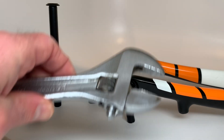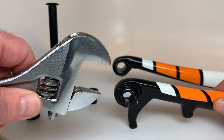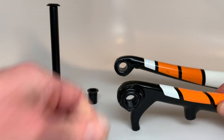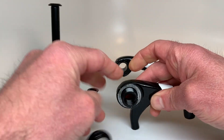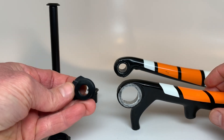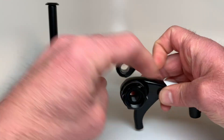Conversion is pretty simple. You'll need a 1 inch spanner wrench — 25.4 millimeters for those not in the US. Take the nut on the threaded side and loosen it up, then simply spin it off. At this point you can remove the old dropout insert. Take the new JJBP insert, get that lined up in the dropout, and reinstall your nut.